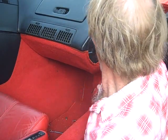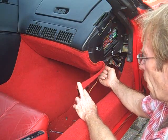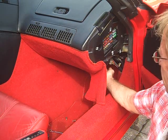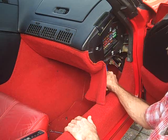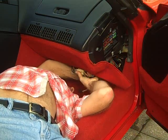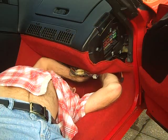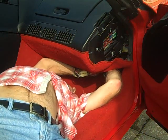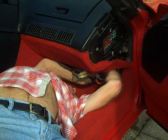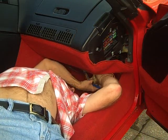Now the CDM tuner box is located right up in here. There are several ways to go about getting this out from this point. There are several connectors that are attached to the panel that goes below the CDM. We're going to pry these connectors down and loose. These connectors all slide sideways to release from the clips that are on the bottom of this panel. Removing these connectors down allows better access to the CDM box.